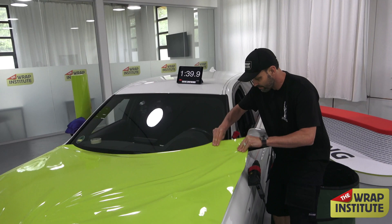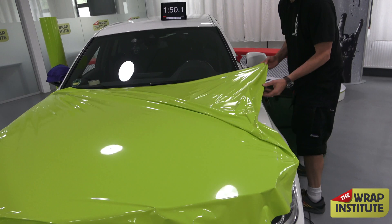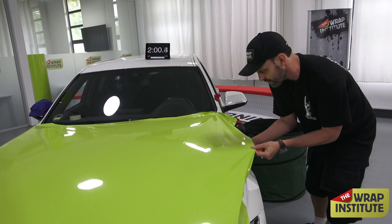Now I'm going to do a technique I call making a bed. It's no different than how you make your bed at home — when you put a sheet on the bottom of the mattress, you hook the corners, and when you hit the last corner, everything goes flat on the bed, the sheet goes flat, nice and tight. Wrapping cars is exactly the same way. If I pull the material to the corners now, all the material goes wrinkle-free.